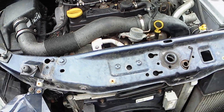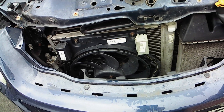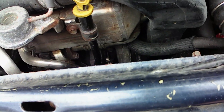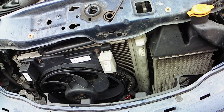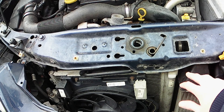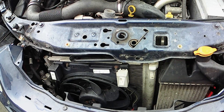One of the main problems we've got is access. You can see here I've taken the main grille off — that's fairly easy, just three bolts. Then you push-clip each of these in — don't just pull, otherwise you'll snap the clips. To get in to where we want to be, we've got several obstacles: an oil cooler, an air conditioning radiator, and the main coolant radiator behind that. So first thing is we'll take this cross member off and see if that gives us better access. It may be possible to just fold the radiators forward a little bit.